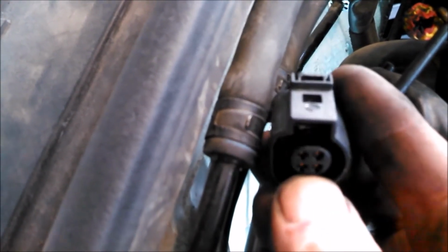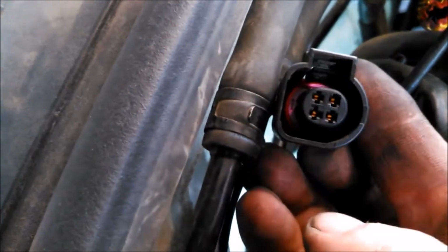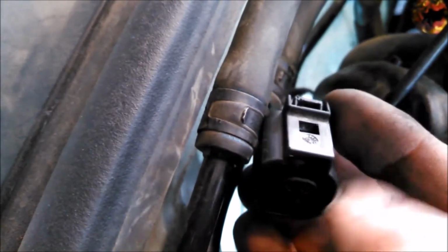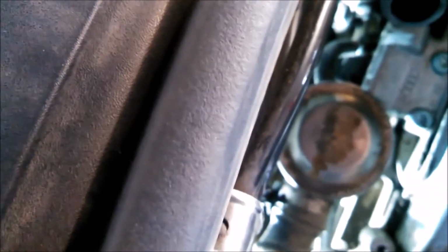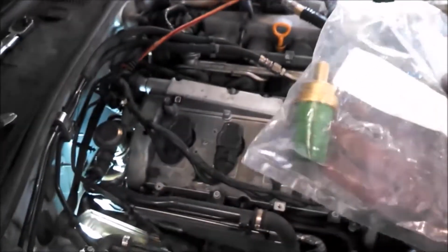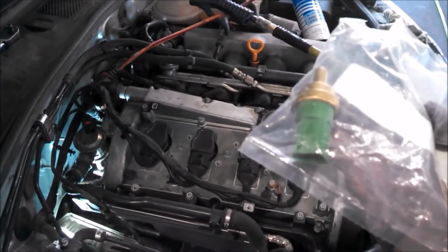Gonna give you a good look at that, I guess. Then you can work it off. So we'll see if there's an O-ring in there, and I think there is. Maybe we can just put some lubricant, just a dab of grease or something on our new one, and drop it down in the hole and snap our clip in place and call it good.